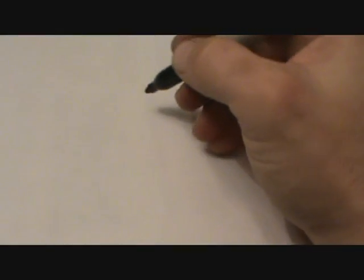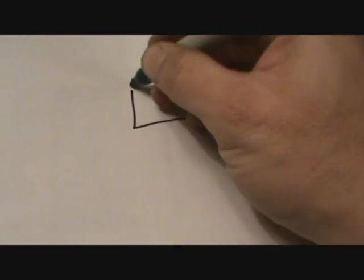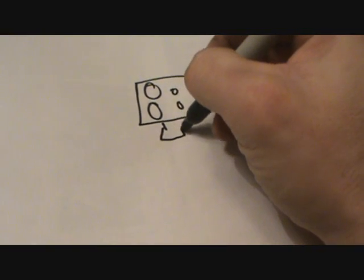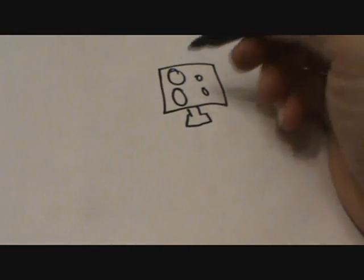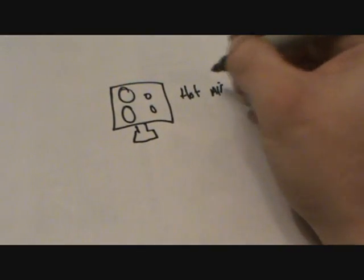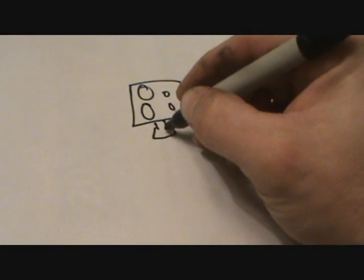let me do a quick diagram for you. This is a hot air choke, has some different lines and things, and a heat stove on the manifold, and some lines run around. A lot of people don't know what those are, and they don't know how to connect them and route them. So first thing we're going to do, let's say we have the carburetor here, choke assembly here. Next, this is a hot air choke, like I just told you. That means it uses heated air to unwrap the choke spring in here.